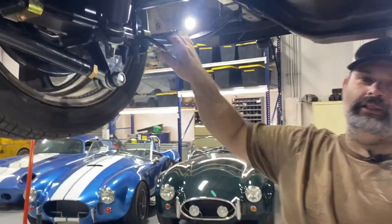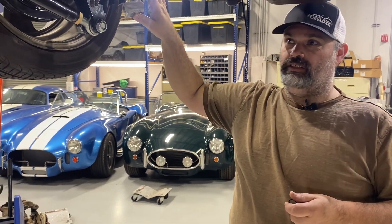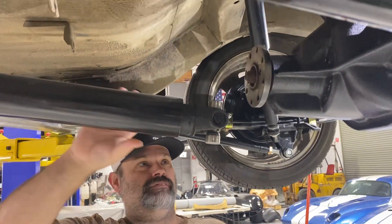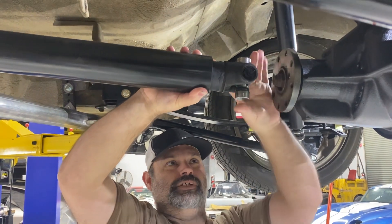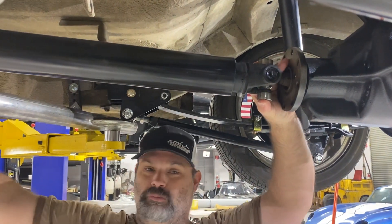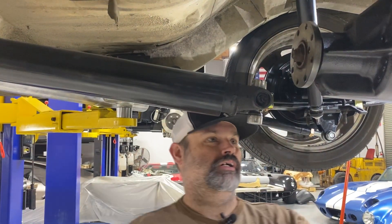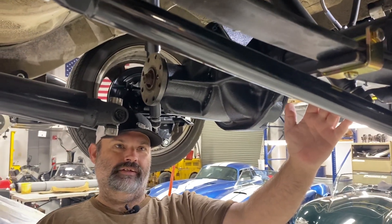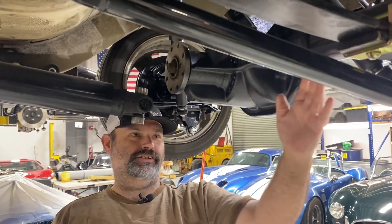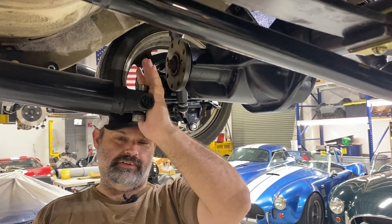That's only if you're running the Cal Track mono leafs. If you're running stock leafs you won't have to deal with that. As far as driveshaft connection, stock length driveshaft — once you add the flange and get the conversion joint it sets you up with the right amount of slip up at the back of the transmission, bang right in — but only if you move the rear end that one inch back. So just to recap: this rear end centerline has been moved one inch back, which allows you to run the stock length driveshaft. Everything marries up with the conversion joint.